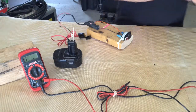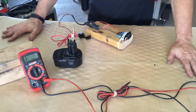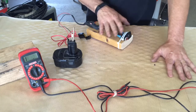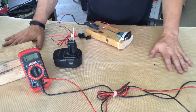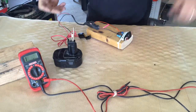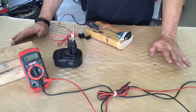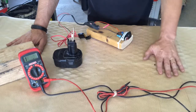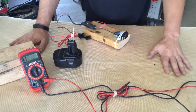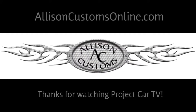That's how you test a circuit for voltage. It's a little more complicated in a car, but only because it's spread out — you may need to add longer leads to your tester. Remember that cars and motorcycles are for the most part negative ground, so anywhere on the chassis not covered in paint should provide a good ground, but you should always check your circuit. The average car works in the 14-volt range when running; the battery will drain down to as much as 10 volts if sitting for a long time and still start. We'll be testing continuity next time, using the continuity feature on your multimeter. Thanks for watching Allison Customs Project Car TV — like us on Facebook and check us out at AllisonCustomsOnline.com.